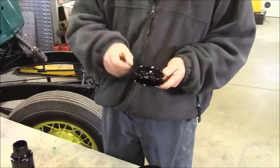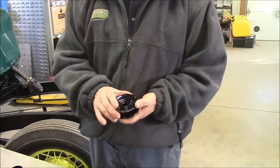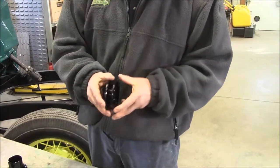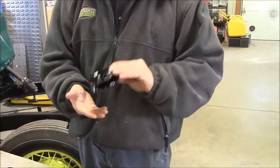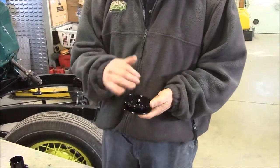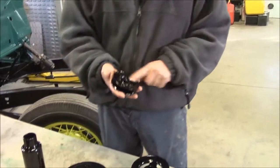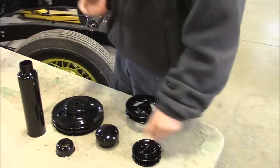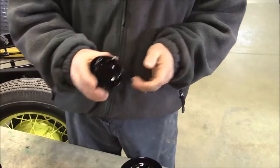So rather than sanding this by hand, epoxying it and sealing it, applying gray high build primer, and sanding it out, you can see we have these rivets. It would be very, very time consuming to sand and keep turning this over and priming and sanding, getting it to final 400 grit, and then applying a gloss black paint. We thought, you know what, why don't we try doing some of these black accessories that typically would be high gloss black.